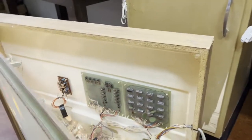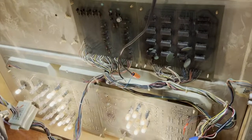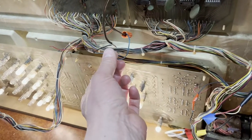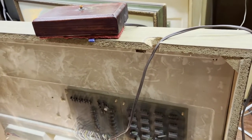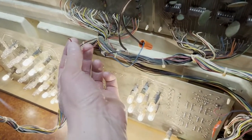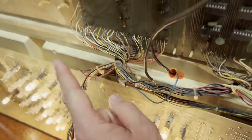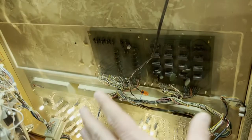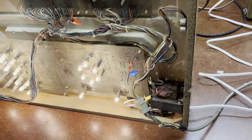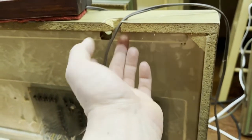This game doesn't have any of those. Going back to the first one, you can see the spots where that board would be placed — the spacing is a little different but generally the same. This is filthy on the inside and needs to be cleaned. Here's the blue and black wire wired to a wired controller, which is another way of doing it. All the controller is is a single push button — that's how you play the game, and it's two player. Looking at the red wire, it's crimped but not actually stripped off. This tells me this panel never had the receiver or wireless option — it was always a wired panel. It looks like there's an extra hole on the top, possibly from someone trying to mount it wrong, but you won't see it when mounted on the wall.